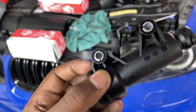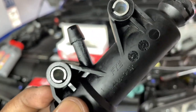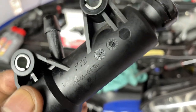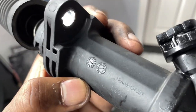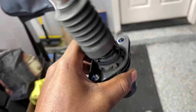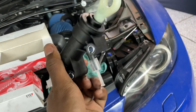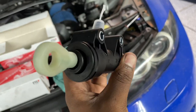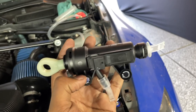If you're curious about when your master and slave cylinders were made, you can look at these two little clock-looking date code indicators. The one on the right indicates the month — looks like September, pointing to nine for mine. The other one is the year — it's going to be 07, so 2007. The old slave cylinder was October 2007, so both are '07 parts and very old. Installation is the reverse of removal — just take off the plastic caps, put them in, and we're set to bleed the system.